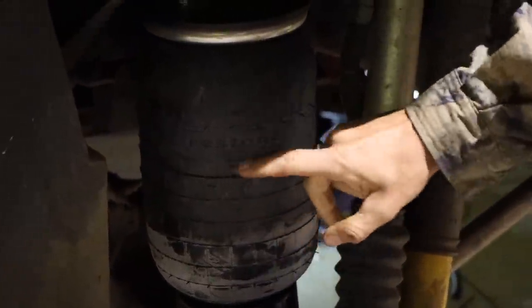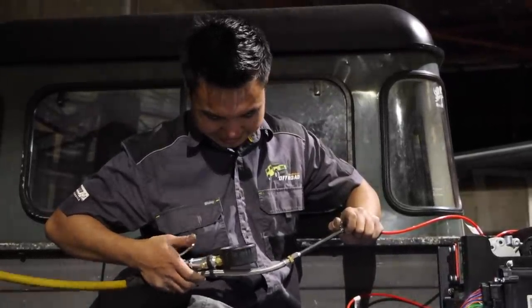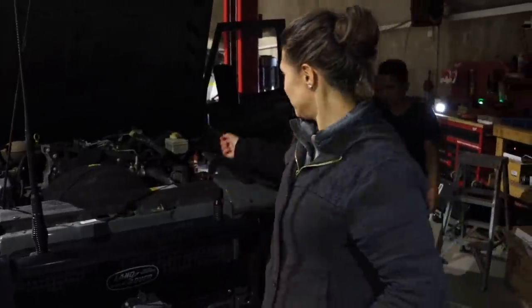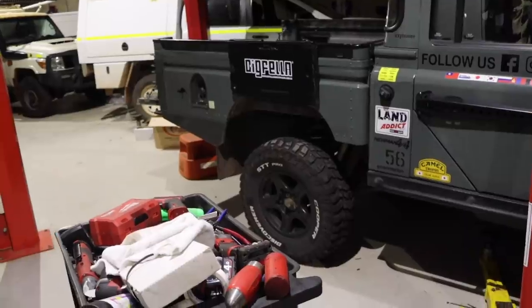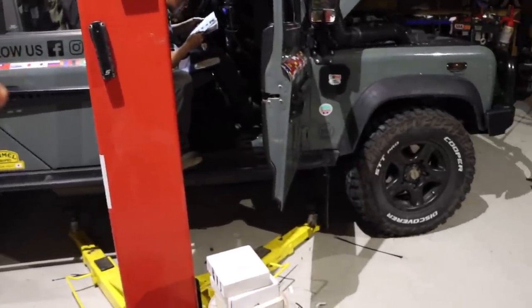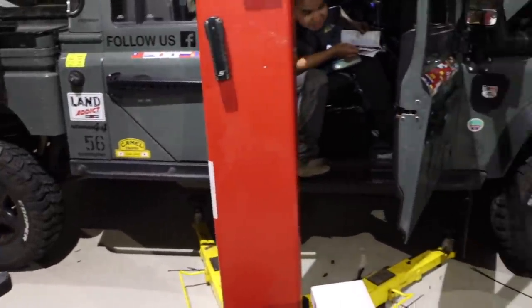This is the initial test. We've got 20 PSI. Johar's going around individually on the T-pieces — the backup lines — and putting 20 PSI into all four of the bags, which is the minimum pressure. That's a good height. If you need to pour oil in your engine bay, you can put the function to 'load down.' It's nearly 9:30 — unbelievable. Everything's packed together. It was an insane amount of wiring and now it's a matter of setting up all of the ride sensors.